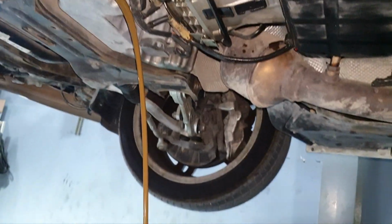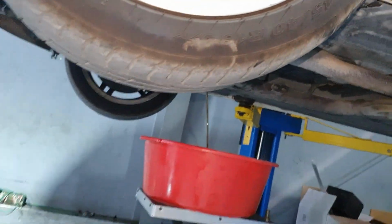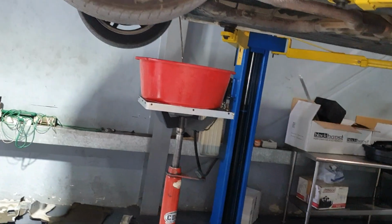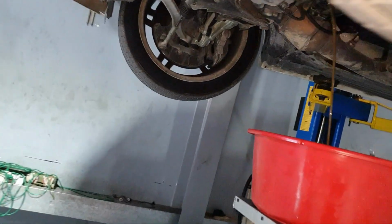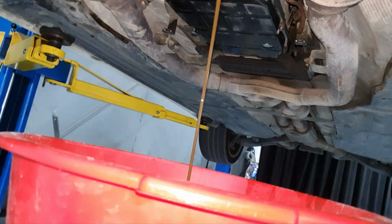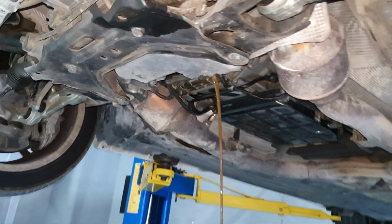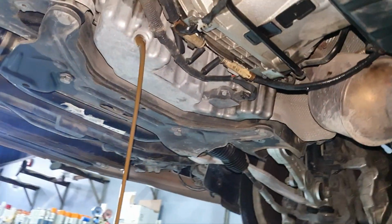It's not only that it mixed, let us say, the coolant with oil. It's that you're contaminating everything inside. Plus, you have a steel camshaft, you have the bridge with the steel shafts, you have the crankshaft. You have so many steel parts inside that if you keep it long, you're going to see all of them corroded. You're going to have some rust on it. I've seen that before. That's why I'm saying that.